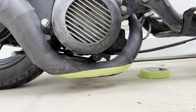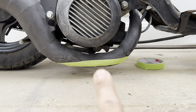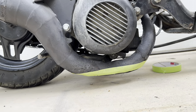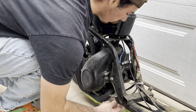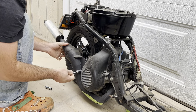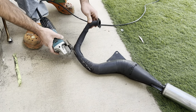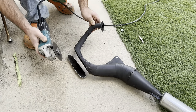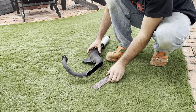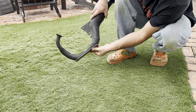Here's a visual to explain it better. Where that piece of tape is, I'm going to cut right there, and then put a flat plate under it and weld it on. So now instead of an inch of space I will have almost two inches. So when I drop the scooter that inch, I will still have room. As you can see I've cut out my little piece of metal — that will sit right here and reduces my low point.